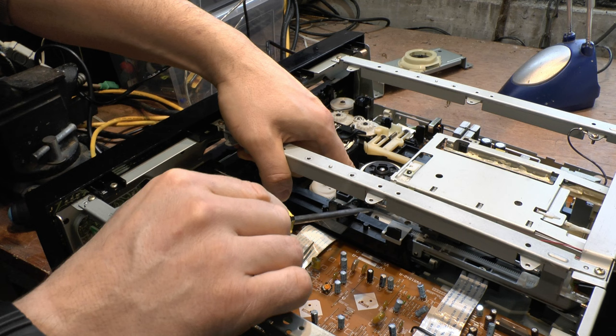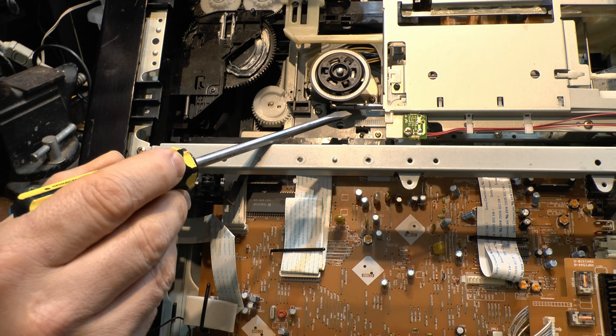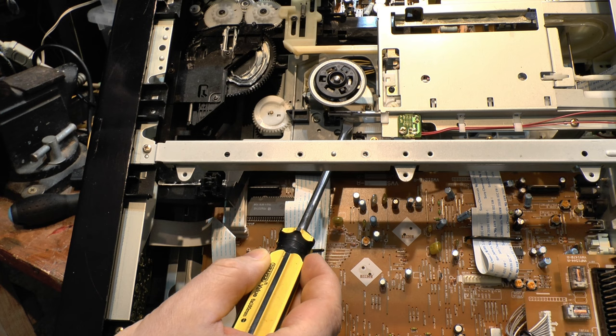The bar has popped up. I'll bring it down so you can see — this bar here is what you're popping up. Come down here, just turn the screwdriver over gently and keep your finger on the end so there's not too much pressure on it. You want pressure under here but you don't want to strain the plastic on this end. So I usually put my finger on top of this piece and turn gently — that way it's still lifting but it's not going to come flying out and snap off.